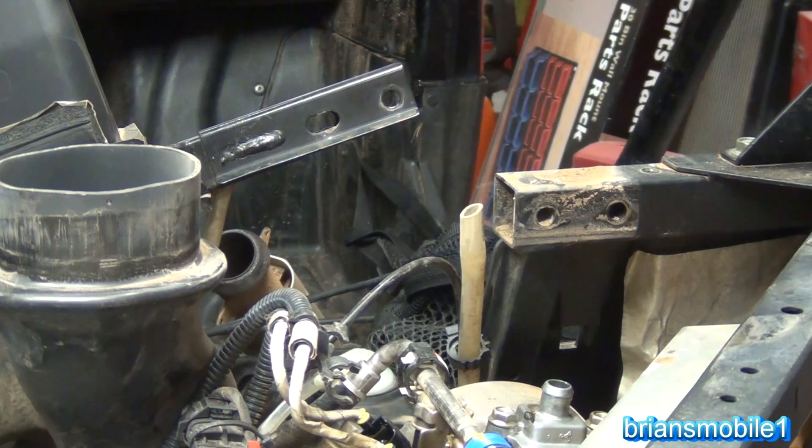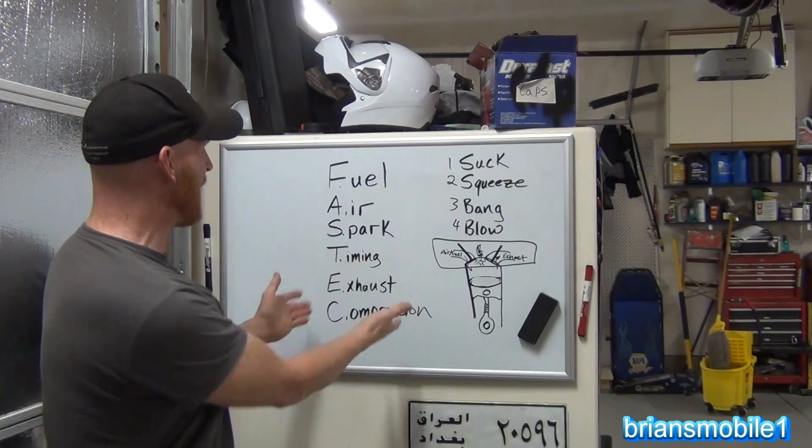The borescope goes into the back cylinder. What you see is very rough — it looks like it was cast, not milled — full of gouges, full of problems. You can see little holes along the side of the piston. There's actually a little piece of piston ring floating around in there. The other piston looked meticulous — it looked great — but there's a little bit of coolant in it, some droplets, and what looks like black antifreeze striping down the side. And there's that little piece of piston ring right there. Jackpot!